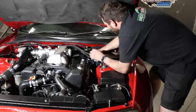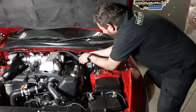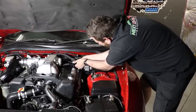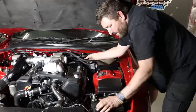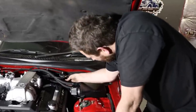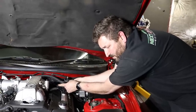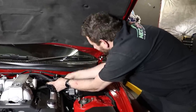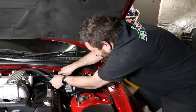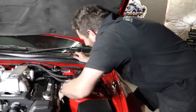So is it still going to be the same size shot? Yeah, just instead of adding the fuel at the nozzle, I'll add the fuel with the injectors so I can control it. Because it's got a 75 pound base, I think the fuel jet's too big. I'm not going to use it to do enrichment while it's under load, because I'm not crazy anymore. I was going to spray it and use the fuel to add, but now I'm a little bit scared.